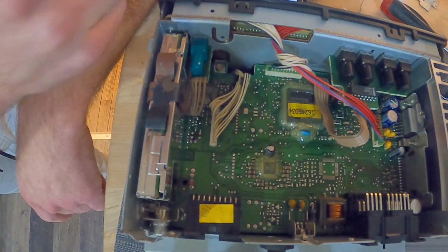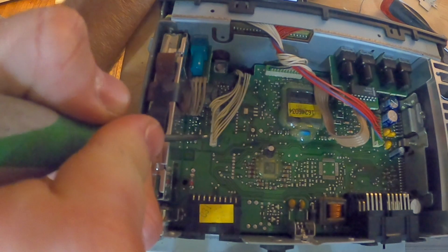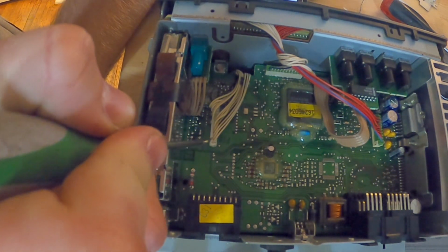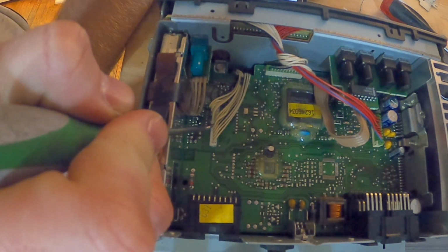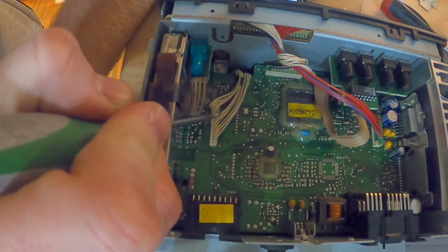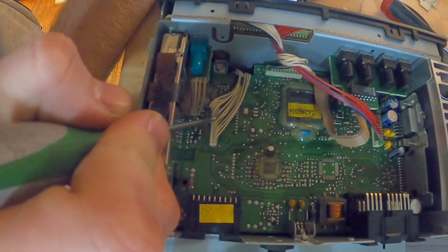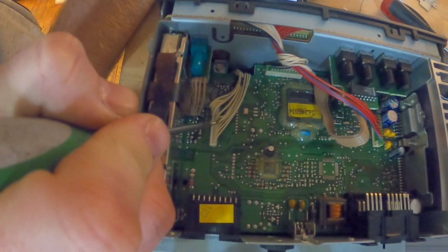we have, it says the 7th wire from the back of the connector is, so we'll go 1, 2, 3, 4, 5, 6, 7. So the 7th wire on this connector is the power for the CD player. So what you're going to do with this wire, the 7th wire on the connector, and I'm going to verify that I have the right one again.